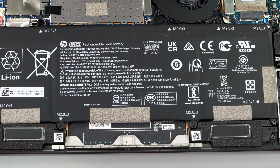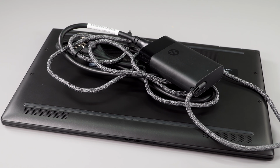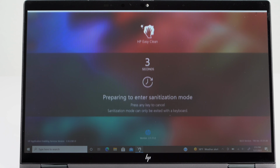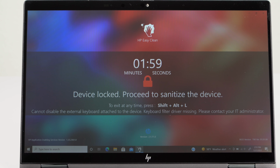The laptop has a 56 watt-hour battery, which is about as big as you're going to see in a 13-inch Ultrabook, and a 65-watt fast charger that can go from 0 to 50% full in 30 minutes. And the 50 to 100% is always slower with laptops, as it slows down the charge and doesn't want to toast the battery. Battery life on this is pretty good. Again, going with the quiet, cool running nature of the laptop, we easily did 10 hours on this, setting the display at 150 nits of brightness and doing productivity, web conferencing, a little bit of Photoshop, those sorts of tasks. So pretty decent in that respect too. And obviously if you tried harder or did lighter tasks, you could get even longer battery life. And that's with the 5G module enabled, by the way, which does, you know, impact battery life certainly.